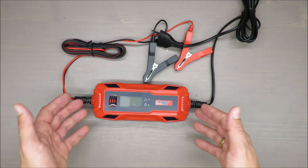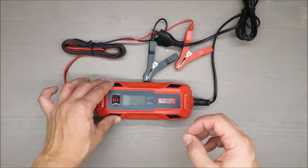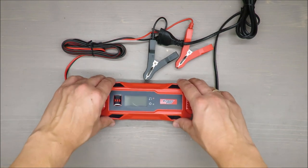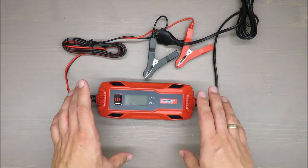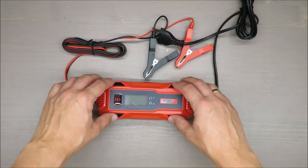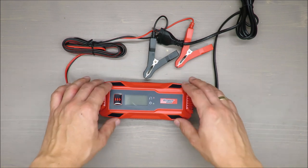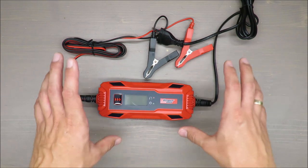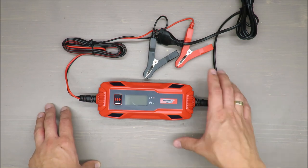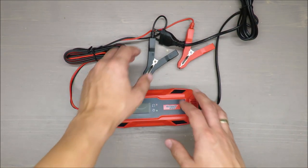Please don't expect it to be a professional tool — it's rather a restoring charger, but not for the full recovery of your battery if it's completely flat. By the way, if the voltage is below 10.5 volts at your car battery with liquid electrolyte, please bear in mind that most likely the chemical reaction went so far that your battery is damaged in the way that you will not restore the basic parameters.